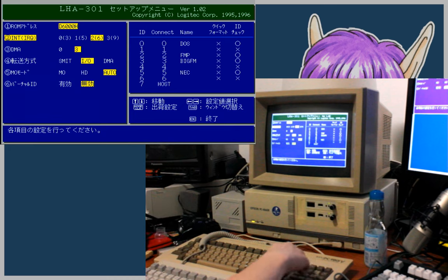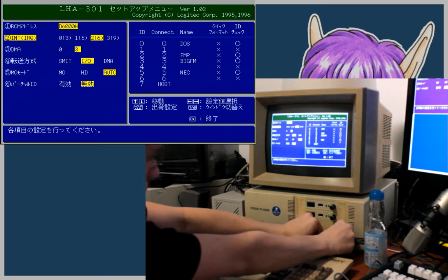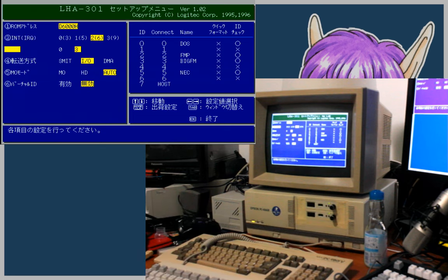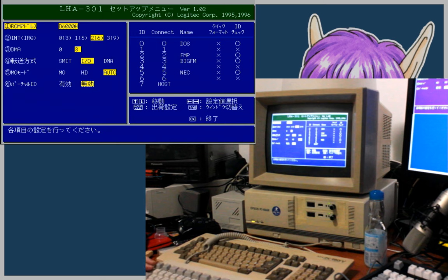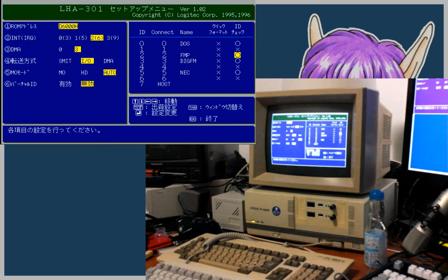And I can page up and down and do whatever. But even here, if I swap the keyboard out, and you probably shouldn't do hot swapping like I'm doing, you get nothing. And then you swap it back, and it works. So yeah, it's just something like that happening. Bad code by Logitech without the H. Yeah, so this is where you can enable certain drive IDs. So here I have an artificial drive hosted on a Zulu SCSI card called FMP, Big FM, and just a DOS one. And then this right here is actually an optical drive that's being emulated